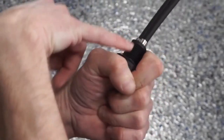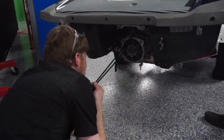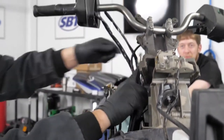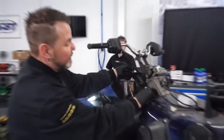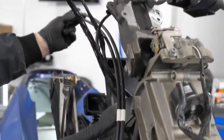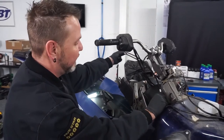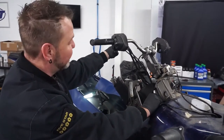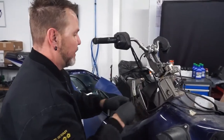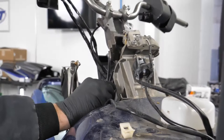It's also worth noting there is a flat on the top of this threaded insert — that flat needs to be on the top. Now we're ready to put on our packing tape back here and our grommet with our new zip tie. It's 21 inches from here to here — it was already marked for us. This is already right in position where it needs to go, so it's going to run perfectly over to our actual adjuster.